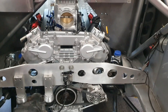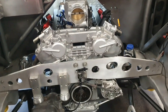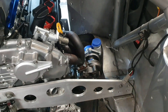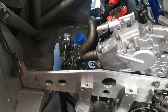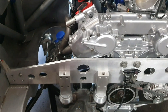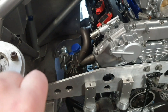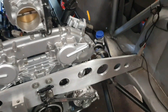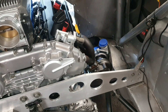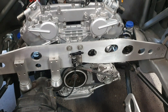Fast forward a little bit - both turbochargers are now in their holes, fit just like the original ones did. As I said earlier they're frame interchangeable, so they're all clocked exactly the same as what the other ones were. Just making up my mind whether I go fancy and get some V-band clamps for the outlets and inlets. It's possibly just extra weight and extra money with no real performance gain - we're not going to run mega boost, maybe 20 psi, probably no more than that.